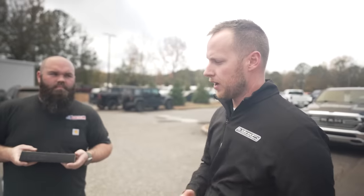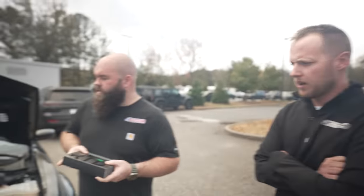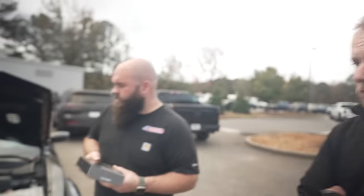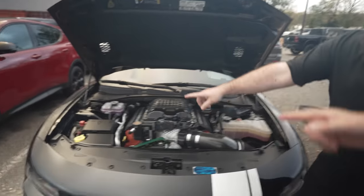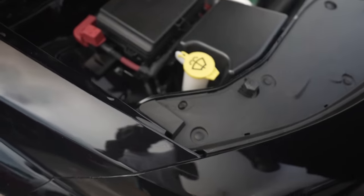That gets you into the 93 Ghoul. If you want to go full E85 after that, you would add the pump kit if you're in a Hellcat, not a Red Eye, plus a FlexLink so you can read your ethanol. And you can switch over to the Improved Racing catch can, which relocates it side mount instead of right there where the idler is going to be mounted. It mounts next to the washer bottle, nice and tucked away so it's not hot when you go to empty it.